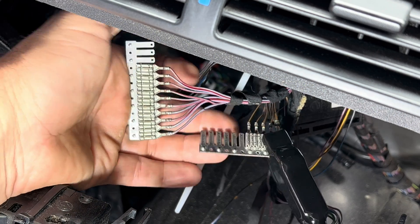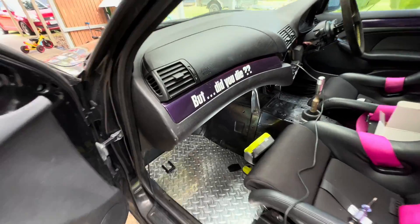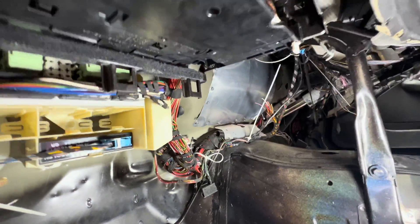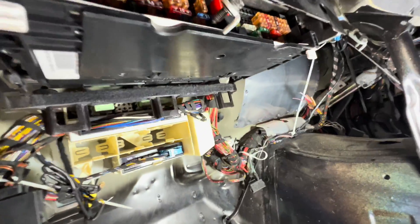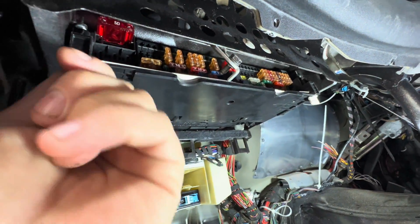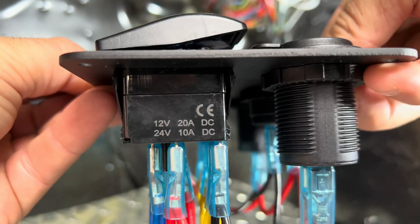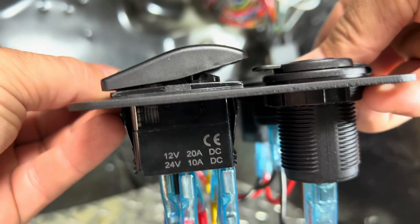So the illumination side of the switch we should be able to just wire into these two here. We know we're getting our power for the lighting off the light circuit. Now we'll look for the power for the actual switch. Lucky for me I've deleted some accessories from this car, so I've got a lot of unused circuits we can use that are already fused. You probably already know where the fuse box is. The switches on the switch panel are rated to 20 amps, so we don't want to run a circuit with a fuse higher than that.